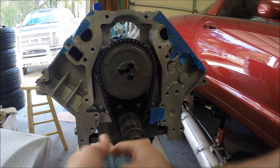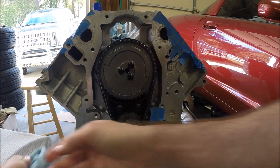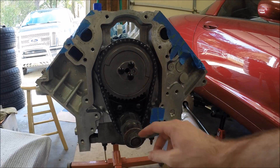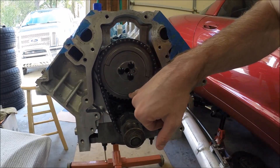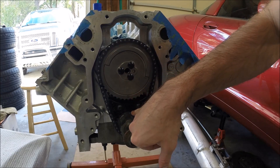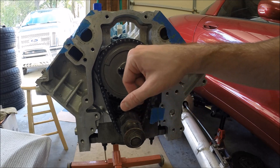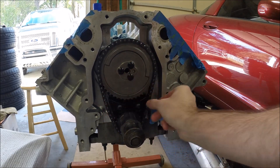If you're doing this the first time — I've already done a couple of dry fits just to make sure things were going to line up — before you torque these down, get them in there and get them snug, but then rotate the crank over at least one full revolution and make sure your timing marks line back up again. If they don't, something's off. And make sure there's no interference and that the chain doesn't get overly tight in any particular spot.